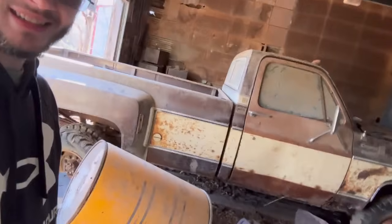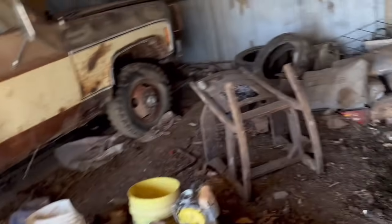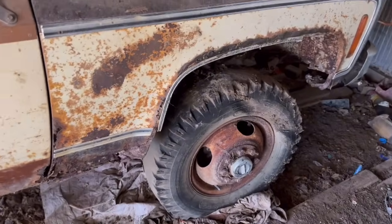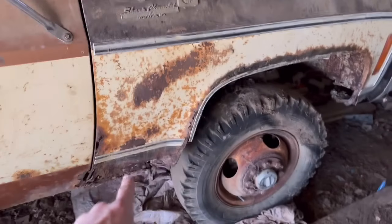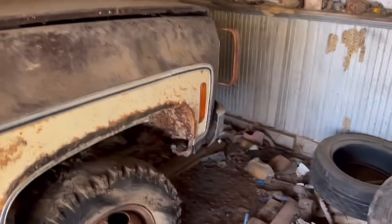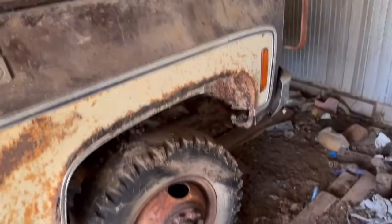But yeah, it's not pretty, but I'll do a quick walk around with you. So story goes, he was going to town and got to town just fine. He drove from town back to home, and he felt as if the starter had kicked into the flywheel and kept spinning. And whenever we hooked up power to the battery, it was immediately trying to engage.